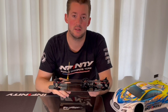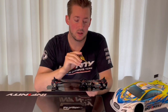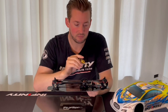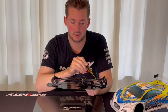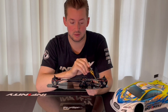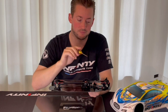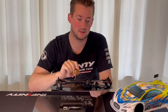One thing I tested the last couple of practice sessions and it works very good: sometimes you would like to tighten the rear belt a little bit more, but if you move one step more tight it can be a bit too tight. So I like to keep it in the middle position and then put a 0.2mm shim under the rear belt tensioner. This makes it just a little bit more tight but it's still fairly free, and the front is still just a tiny bit tighter than the rear.